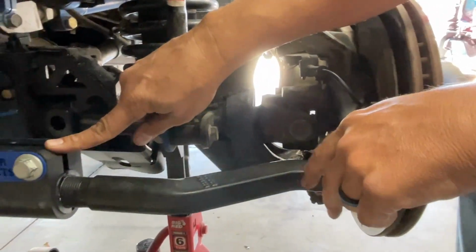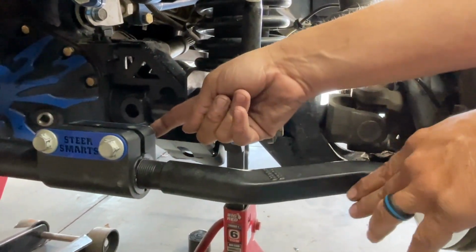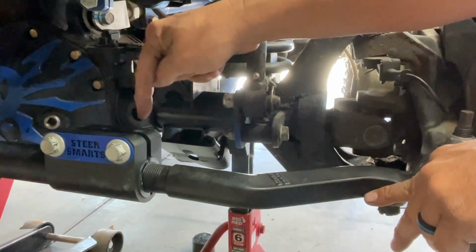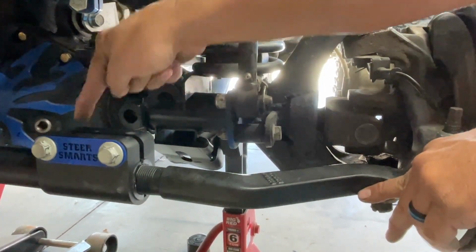Moving over to your clamps, this is going to be a 16 and an 18. Make sure you have your spacers in there. And I was told as you tighten these down, they go to 85 foot-pounds. You want to alternate back and forth until you achieve torque.